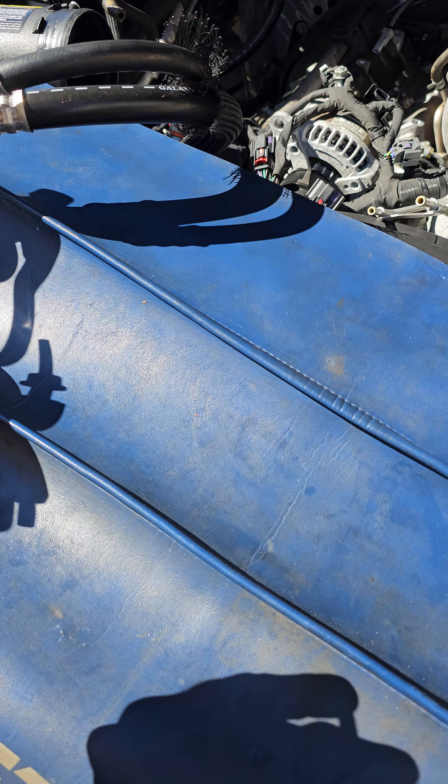If you break it off it'll look like this — this is what the nut looks like when they snap off if you go too fast. This particular one fortunately had enough room left over for me to still grab it. So what I've done is broke the 3/8 one off and then welded a 5/16 nut on there. The 5/16 coarse thread is very close — not the same as, but very close to the thread pitch that's on these bolts in the manifold. This one here is now cooling and I'm about to use a half-inch wrench because it's a 5/16, not a 9/16 on this one.